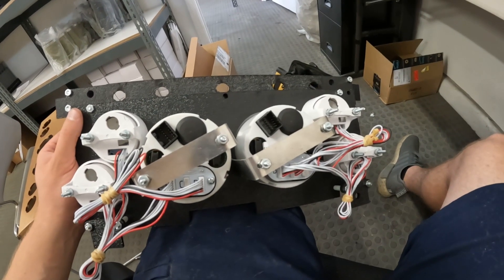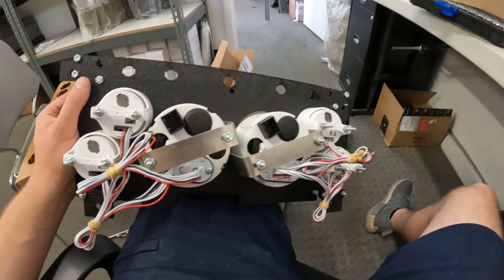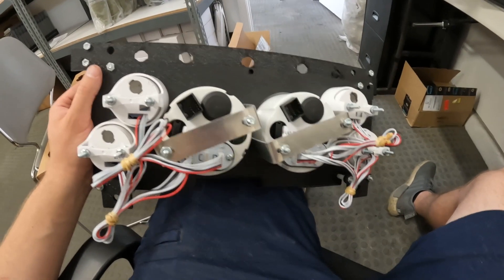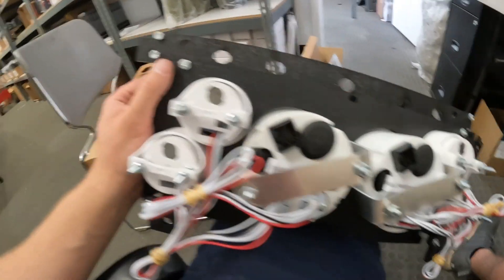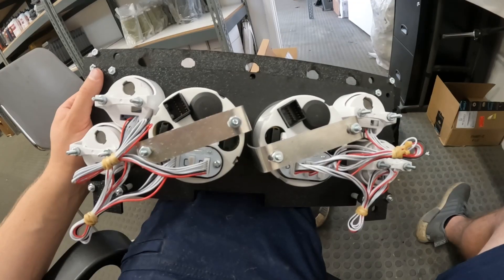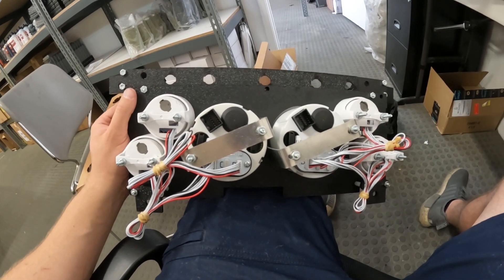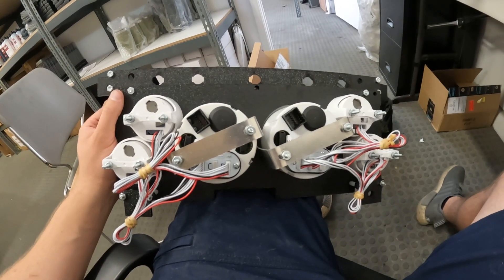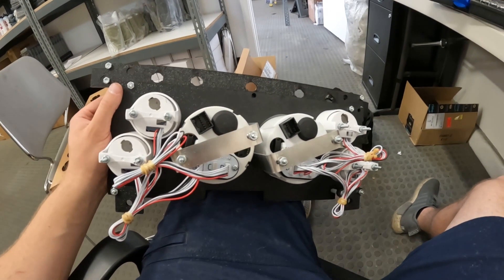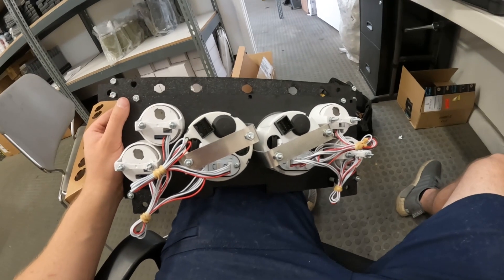The only difference between this and a Dakota Digital: I've done a lot of Dakota Digital gauges and pretty much the only difference is you're going to have to run two power and two ground wires. These two main gauges — your speedo and tachometer — will power your other two gauges. A Dakota Digital has one main computer box and the wiring runs from that to the gauge system, whereas here you wire everything to the back of the gauges. The difference is negligible — two extra butt connectors is all you're really doing.